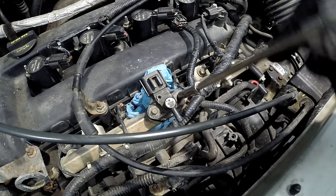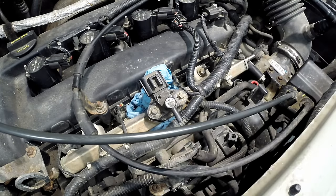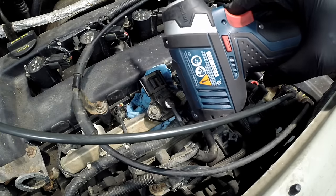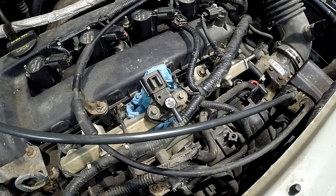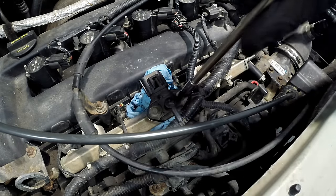You want to pull these off with hand tools only. Electric impacts use brushed DC motors, which cause arcing when the brush goes over the commutator face — and you don't want sparks next to fuel vapors. Many people don't think about that, so I want to put that out there.